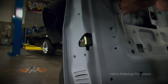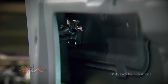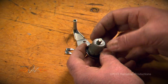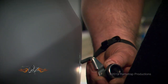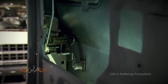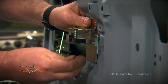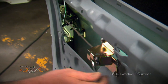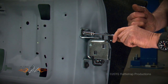Once it's laid out, the first thing to go in is the mechanical stuff, like the door locks and the latches, because they usually mount back behind everything else. The latch assembly is connected to the interior and exterior handles with special rods, and it's important to get those working right before you move on. The upper and lower hinges will get their final adjustment when the door is on the vehicle, so we'll just get them in place for now.